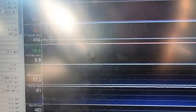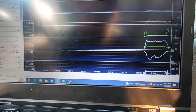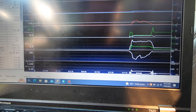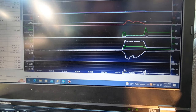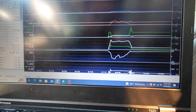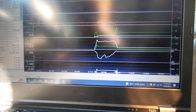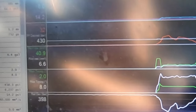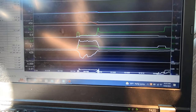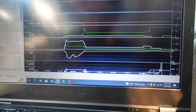Okay, now I look like a huge a-hole because it just started up totally fine. It started fine and then it shut off — meaning we had a slug of fuel leading toward the injection pump but we had air following it in, and now it shut off. So I think if I crank this again we're going to see that we have no fuel pressure. And as expected, no more fuel pressure available.